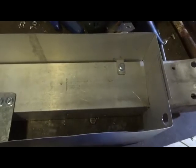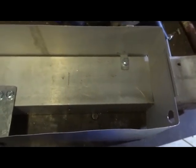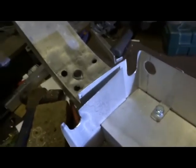Okay, this is taken from inside, or the back of the car. This is inside the bumper bar. I pulled the bumper bar off to put some 8mm nutserts in there to support the brackets, which are the 3 bracket supports there. And then I've made this shroud up. The radiator inlets come in and out through there, the drains at the top. Got to make a couple more holes there to clear the mounts. The mount at the bottom here is set up.